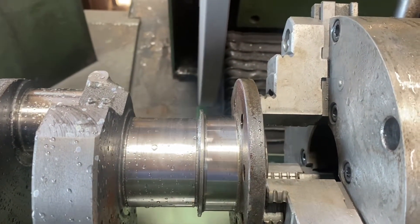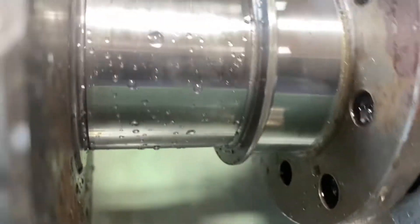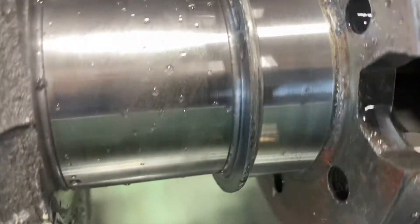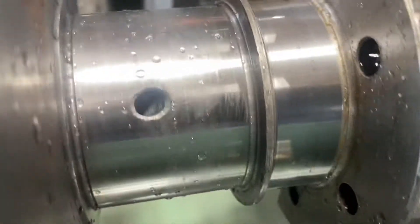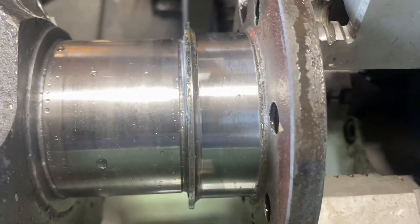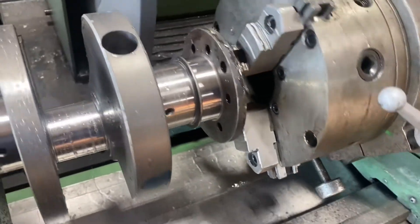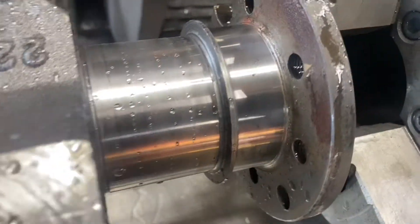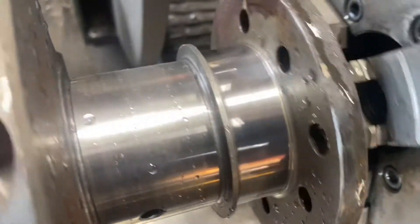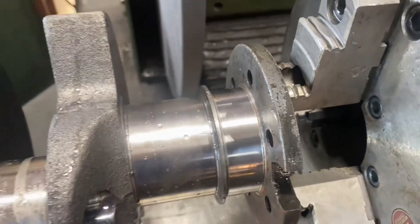This is around about three thousandths off or so. I mic two inch 694 now. I've got a little remnant and a little bit of surface rust from the engine sitting around. I think I'm going to take another couple thousandths off because I'm still well within my published specifications. I came out at two inch 689 — just one thou below the standard spec. There was just some pitting, but there are just a couple little spots left that aren't going to do anything and they're not in the seal area anyway. There's no knurl, so we can use our seal with the non-serrated lip. That is very important if we don't want this to leak.